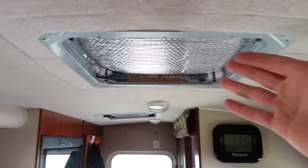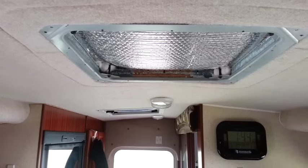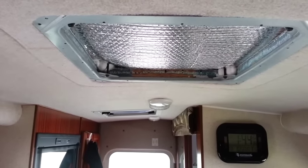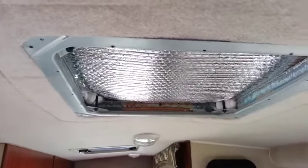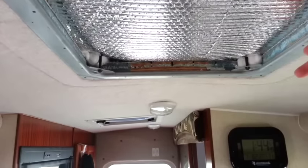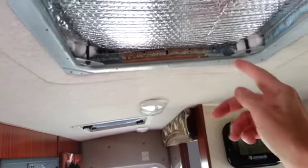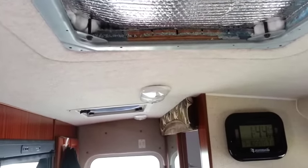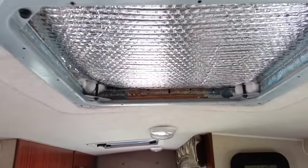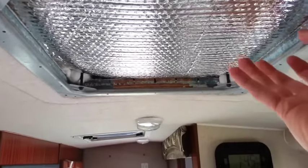What did I do? And voilà — there it is. I removed the cover, the air conditioning cover, the inside cover. Basically, what attaches the cover to the ceiling, there are about eight screws total that install into this metal flashing piece. And then there is the pigtail wiring harness that comes out, with a ground, power, and a negative wire — just like house wiring. You basically just disconnect that wiring, remove the eight screws, and the entire cover can come off.